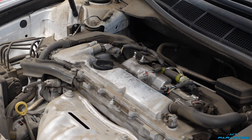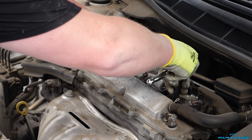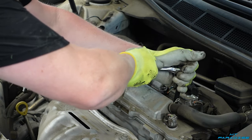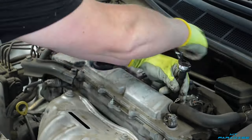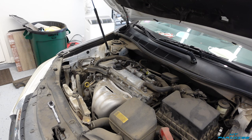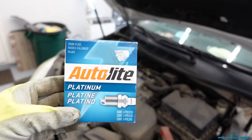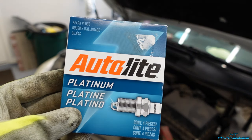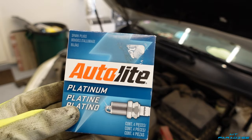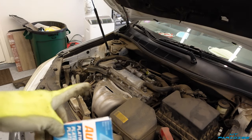We're going to go ahead and drop this right down into the hole, push down so it hooks onto the top of the spark plug, and just go ahead and unscrew it. Now we have all the spark plugs out. We're going to put the new ones in — this is what I'm putting in right here. These are pretty legit; a lot of people use these and even a bunch of big auto stores use them. There's going to be a link in the description down below so you guys can go pick up a set of these for your Toyota.